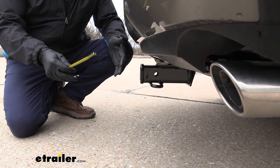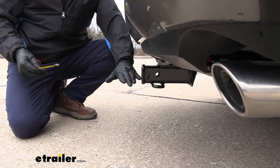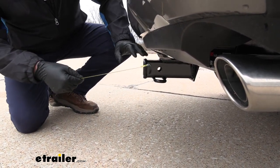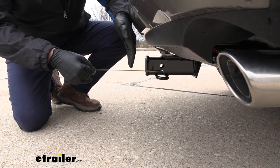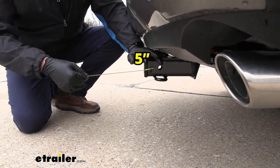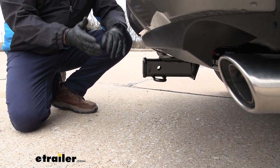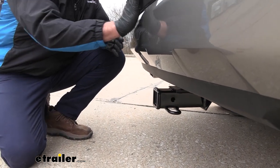We are looking at 11 and 1/4 inches. So keep that in mind if you're looking at a ball mount — you might need to get one that raises up, or consider your bike racks or cargo carriers. That's quite a bit of distance, and that's fine, or maybe you get one with a slight incline. The other measurement we do is from the center of the pinhole to the edge of the bumper, and that's going to be about 5 inches. That's important if you have any fold-up accessories like cargo carriers and bike racks — you need to know how far they'll come out so they don't impact your bumper.